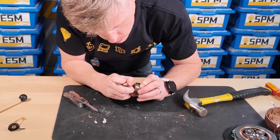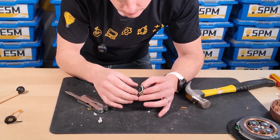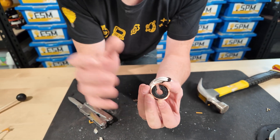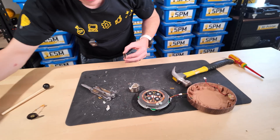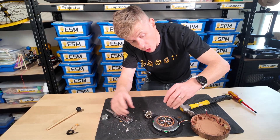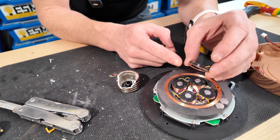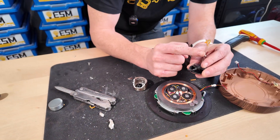But if I go just a little deeper inside, there's one more thing to see. This is the all-important induction coil — this is how the electricity transfers wirelessly from the base to the light bulb. These magnets will be levitating, floating in the air above the base, holding this copper coil in place. This big copper coil creates a magnetic field which inducts an electric current in this copper coil, which travels up into our — now broken — LEDs.